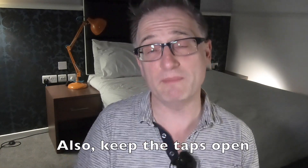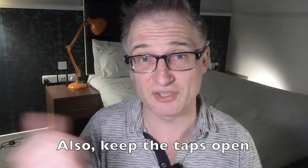Then there's a grey waste tank — open that tap, let all the water out, and keep that tap open so any water that's stuck at the bottom may have a chance of escaping or evaporating. Then what we do is drive around a bit. We take our motorhome back to storage, and as the vehicle is moving along all the water shakes down into the lowest part you can actually get to, which hopefully should be the plug hole.